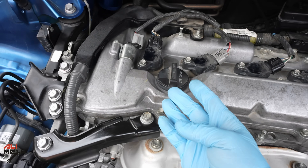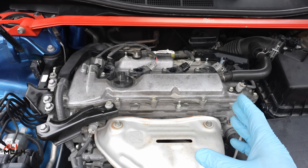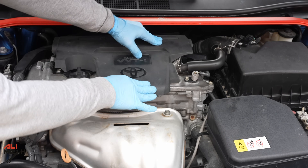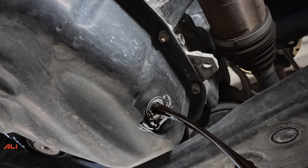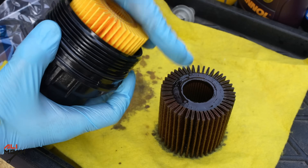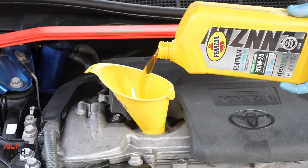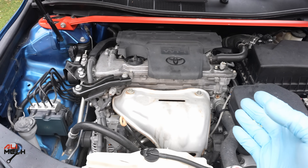Cleaning this filter made a huge difference, but overall engine oil quality is also a big factor. Now I'm going to put the engine cover back and we are done here. Next we're going to change the engine oil and filter — let's remove the filter and change the cartridge, put the drain plug back, install the new filter, and add the new oil. Let's start the engine again with the new oil and the clean camshaft filter basket.